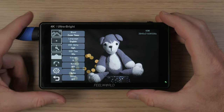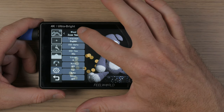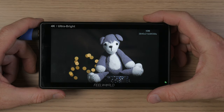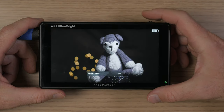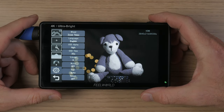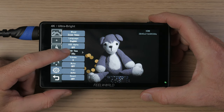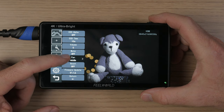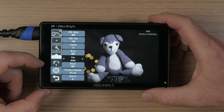The last menu is the options menu. Here you can set the operation mode of the scroll wheel — you can choose between backlight, volume, and zoom. Since you can already adjust backlight and volume via the touch function, I chose zoom for the scroll wheel. Now when I scroll the wheel, I am zoomed in 100% and can zoom in further. Just tipping the scroll wheel to quickly check focus at 100% is a nice feature. You can also set your language, the transparency of your on-screen display, the time it takes to turn off the main menu, the volume or mute completely, and set the fan to auto, high, middle, or low. I always leave it on auto. You can also reset the monitor to factory standard.